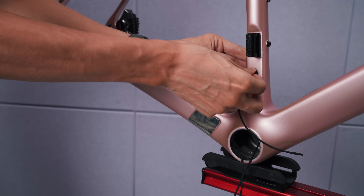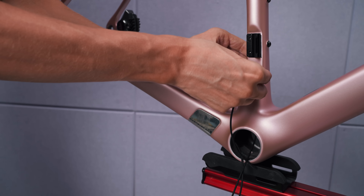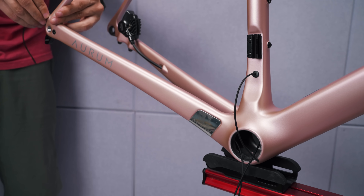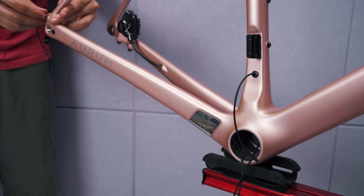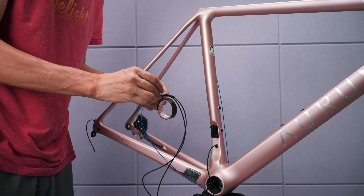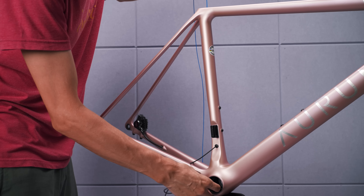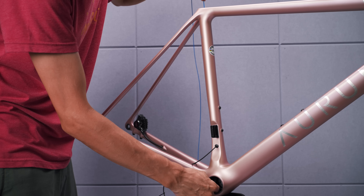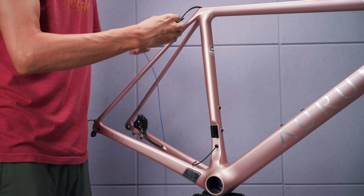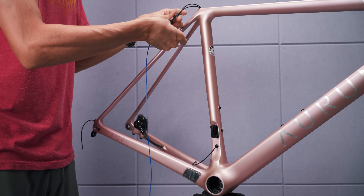In the down tube you really want clips on the wire where the cable has a lot more room to flop around, so it's not super critical at all if you run a semi-wireless 12-speed setup. But since I had an abundance of the old clips, I thought — better be on the safe side. The front derailleur wire in, and then add the rubber grommets that come with the frame. I used my broken internal wire tool to pull both wires up through the seat tube by simply taping them together to the routing tool. But you could definitely do this without any dedicated routing tool — like a piece of string, for example. So definitely not necessary to invest in these tools for this particular frame.